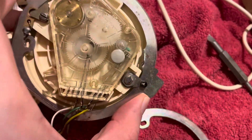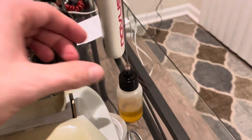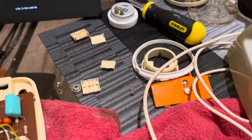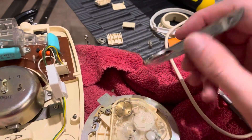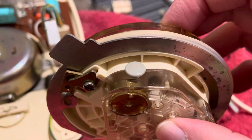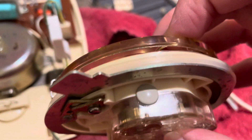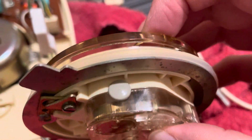I adjusted the dial as well — it's been oiled. I used a pin oiler like this one; this is the one I used. I also got a pair of tweezers and used them to take out the spring of the governor by taking out this little cover. This hole here allows you to stick a pin oiler and oil the governor and all those gears. It was a little bit of work — I had to use the light and look through one eye, but I managed to get it.